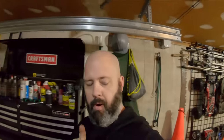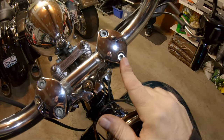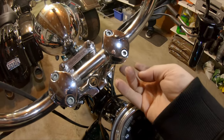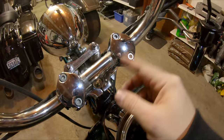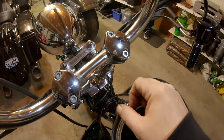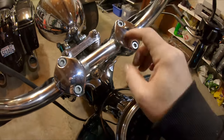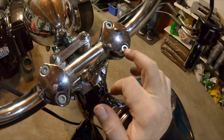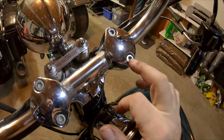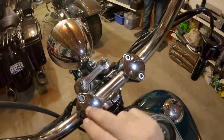We made progress — all positive for the most part, with two learning opportunities. First: aluminum risers and steel bolts don't like to get along. As I was threading it down, the threads in the riser stripped — the bolt just kept spinning. I was worried I'd snapped the bolt, but pulled it out and found threads around the bolt. Attempted to re-tap it but it didn't make a difference. I'll need riser bushings — probably poly bushings — or might end up just getting a whole new riser. At least I've got three bolts holding it tight.